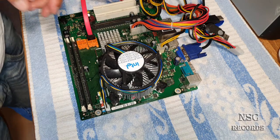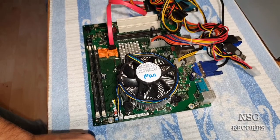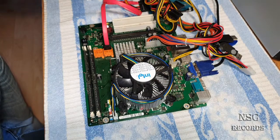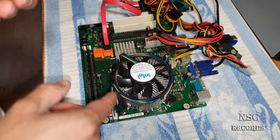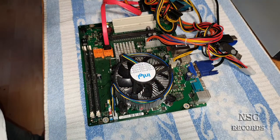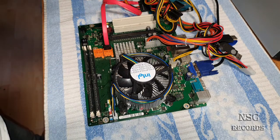The great thing is also that I got really great thermal pastes, which are really nice and not difficult to apply. So Akasa 450 is very nice to apply. And now let me start it, and then we're gonna take a look at the clock. Let's do about 7 minutes, because when I start the system I think 1 or 2 minutes will be just the time for booting. Okay, let's just do 7 minutes for the first boot.